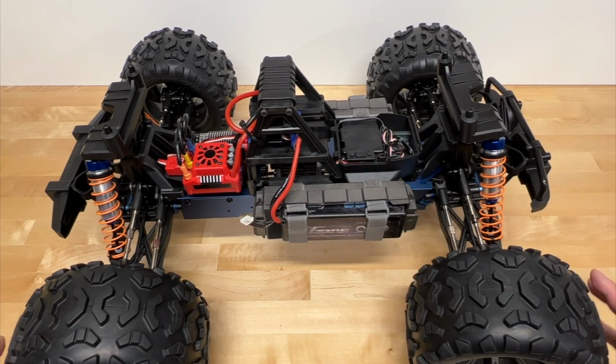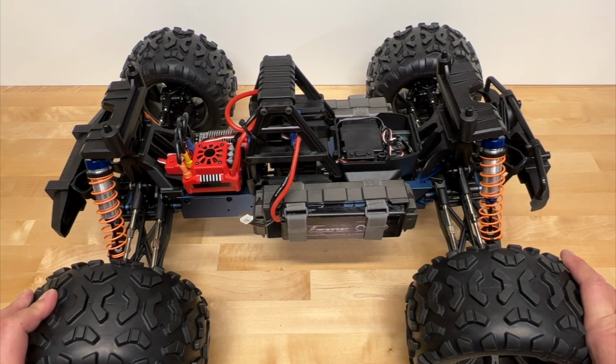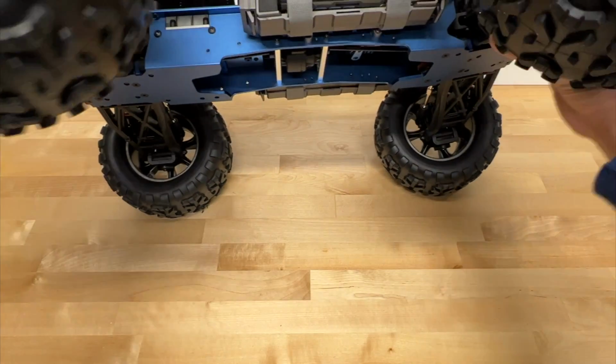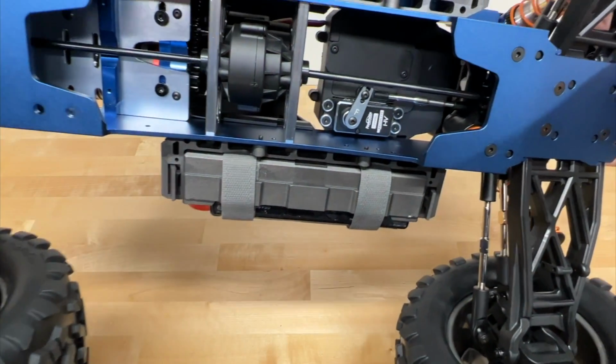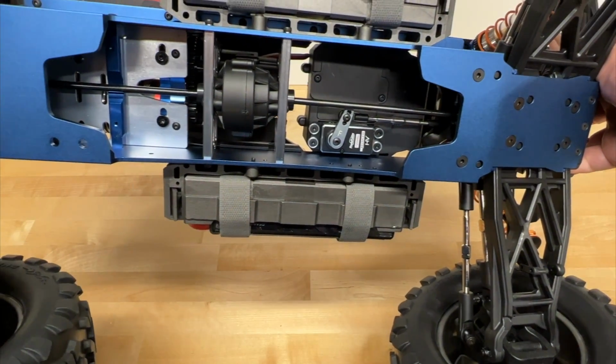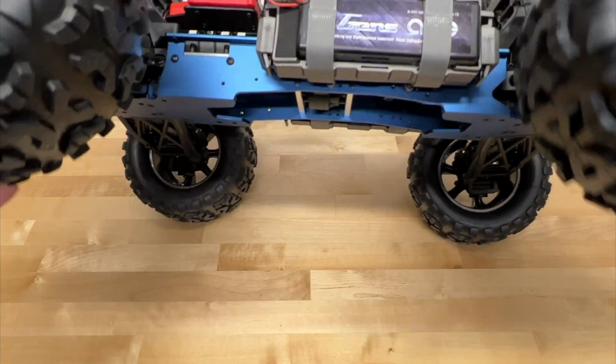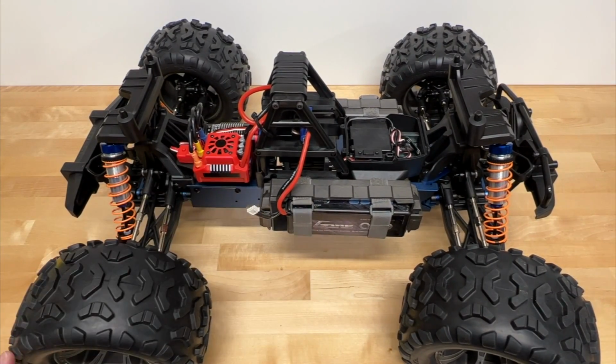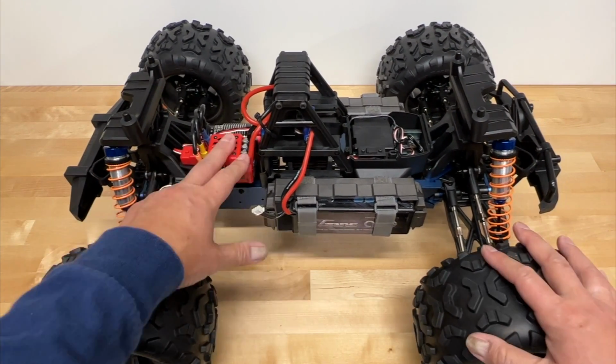And then the servo is a Power Hobby, what is it called? The 729 MBL. You can see that underneath. High voltage servo, so yeah, 729 MBL. First time I've tried this servo, actually highly rated, and I am running it at 7.4 volts off the ESC.